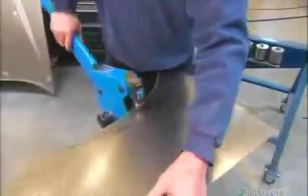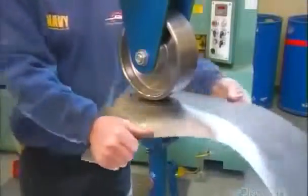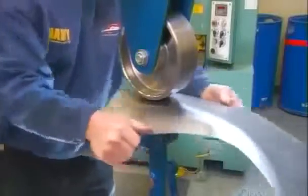To make the wheel openings on the front fender, they use shrinking jaws, a tool that curves metal by squeezing it. Then they switch to a tool called an English wheel, which rolls the curved metal into a particular shape.